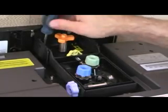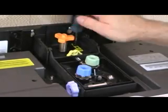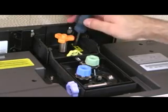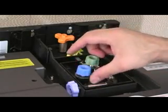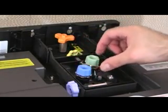After connecting all cables to the projector and removing the plastic lens and plastic mirror covers, turn it on and allow it to warm up for a few moments. At this point, the image may look very odd. Before starting to adjust the image, ensure that all of the adjustment restrictors are disengaged.